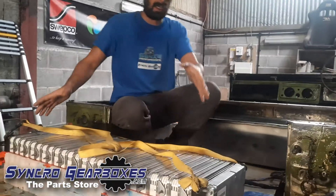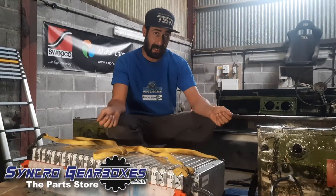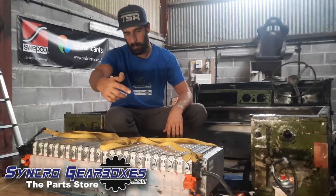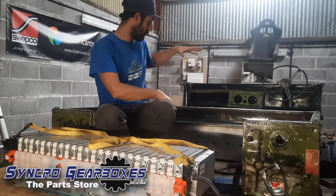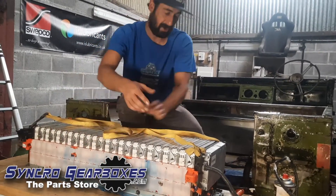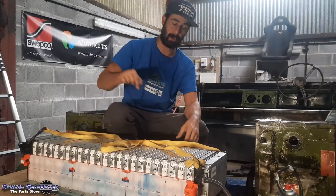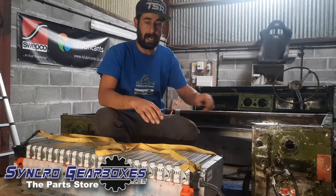The battery pack is entirely unmodified as it came out of the Nissan — you've got wiring, a temp sensor, and all the busbars. We're literally going to pick that up, drop it into the tub, and there are mounting holes that align with box section we've welded into the box so we can fire some bolts straight in with no fuss. We'll pop a hole in it to let the wiring out and that's it.